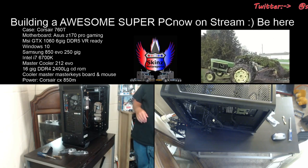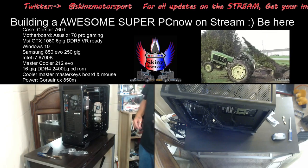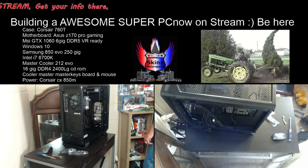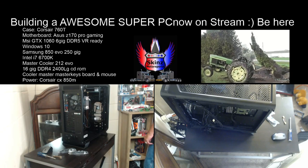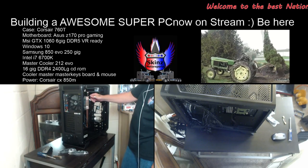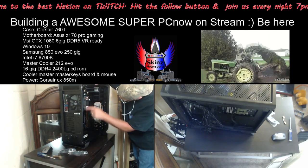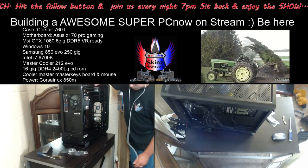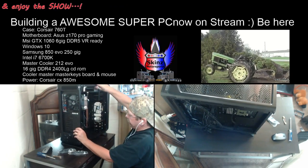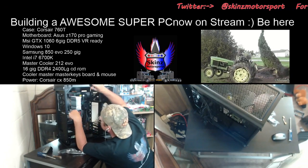Alright. So first fan that we want to hook up is our CPU fan. There's a specific place on the motherboard. Why does that glow? That's for the CPU fan. So, here's our CPU fan connector. We're going to look, and it should be right around this area. It'll say CPU fan. And I see it right here. CPU fan.